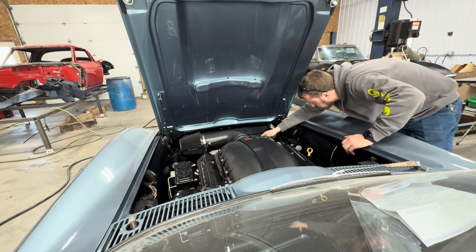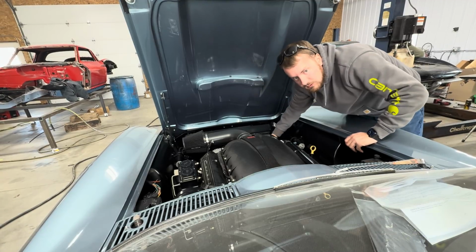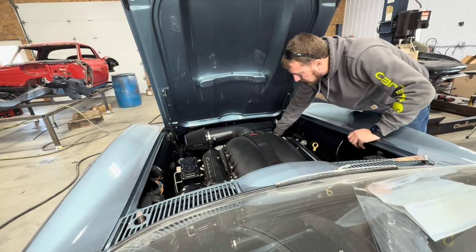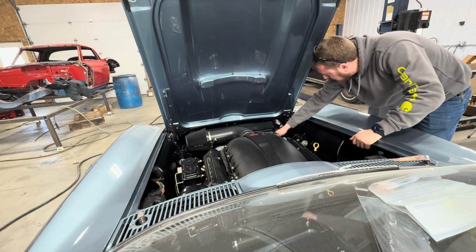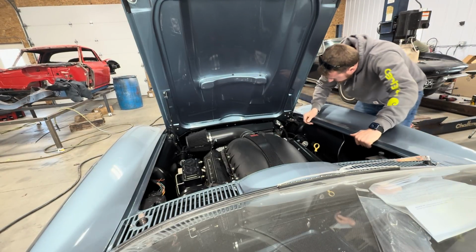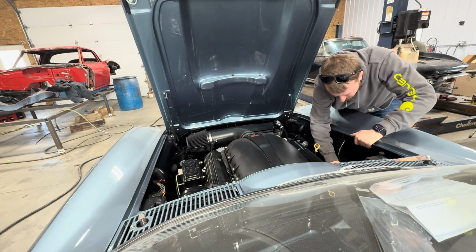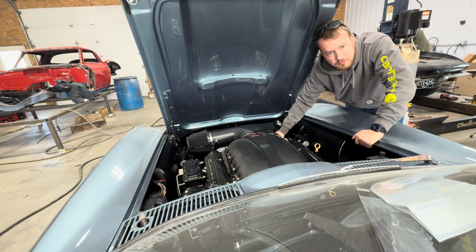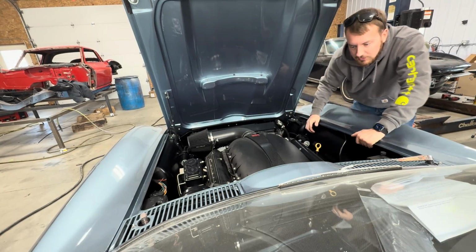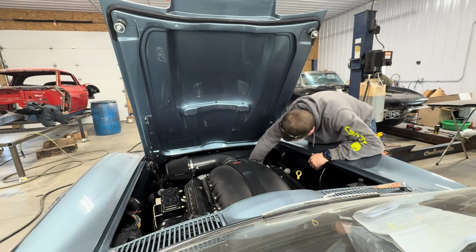Yeah, upper hose is warm. Bottom hose is warm too. It should be 200 degrees warm. And on top I got 230 in the pull. Top feels hotter than the bottom, because the thermostat was stuck in it. And at 200 degrees, you shouldn't really be able to put your hand on it and hold it very long. No, it got to 236 in the pull. The top hose is pretty hot. The bottom hose has that sheathing on it, but it's still pretty warm too.